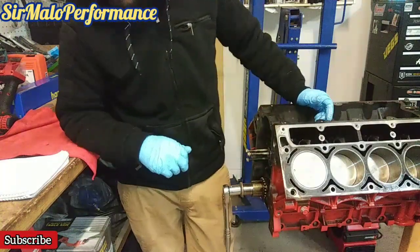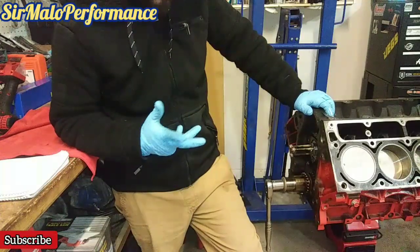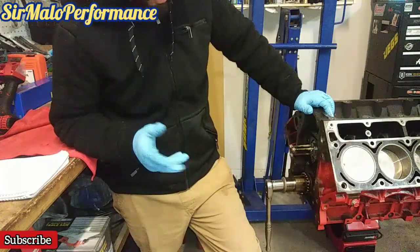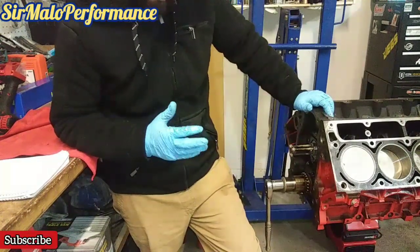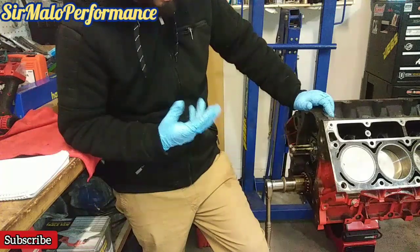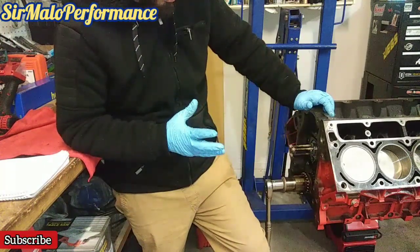But the cam that we went with, it's a custom cam. I'll try to make it available through an online website. You'll purchase through me. It's gonna take a while to get it to your doorstep, because custom grinds, they're not just sitting there. I'm requesting this special kind of grind for this, and it's not a 107 LSA. There's the Truck Norris cam that's very similar to this. The Truck Norris cam is actually bigger by what I would consider a lot for a 4.8, and it's got a 107 LSA, so very choppy, like a thumper comp cam. I'm not into really the choppiness.